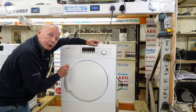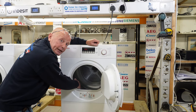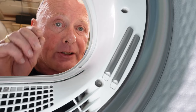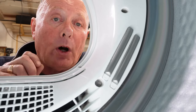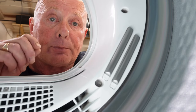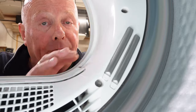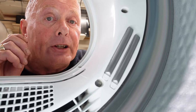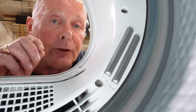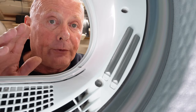This was because they had a fault with the moisture sensor. The moisture sensor is inside the drum and there are two bars on the inside. These two bars detect the amount of moisture inside the drum, and over a period of time when using lint cloth, fabrics with printing on them, and other fabrics like polyester can leave a film on these two bars. When the film builds up, the moisture is not measured correctly, giving the wrong information to the program and therefore the machine turning off early.